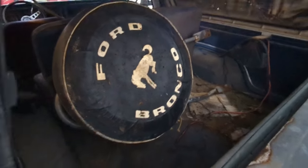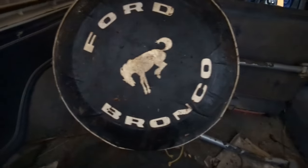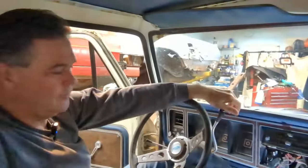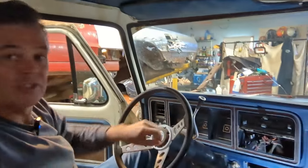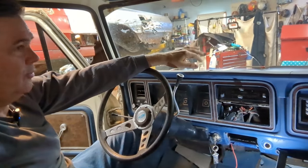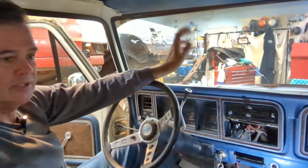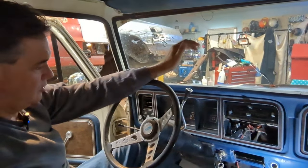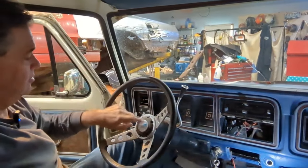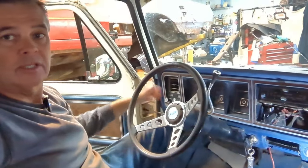I flipped up that extra spare tire rack and there's a Ford Bronco cover on the spare tire — that's a nice looking spare tire cover. I was inside fiddling with the ignition. There were no keys with this Bronco when I got it — that's nothing, you can buy everything you need to replace the locks and ignition switch on most of these old Fords. Probably should replace the ignition switch anyway, and also the multi-switch in the wheel for the turn levers. Start with that before fiddling with the wiring, because I noticed there are some lights out and the turn signals aren't working.